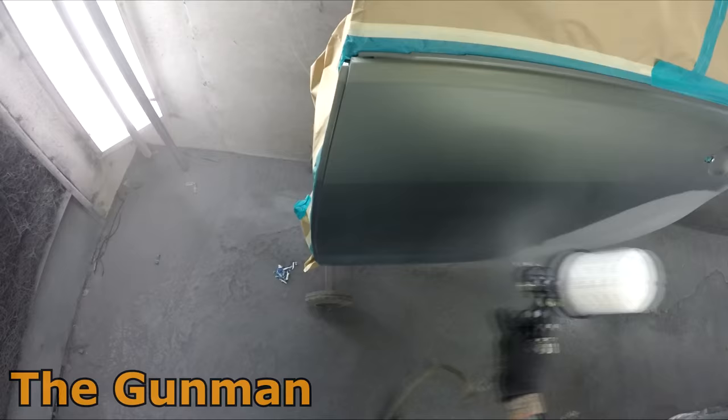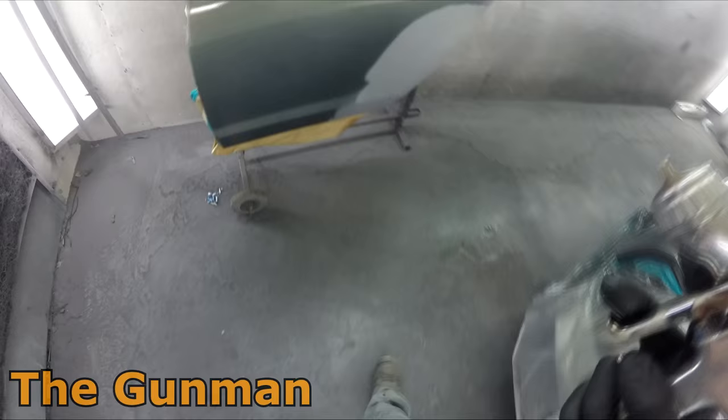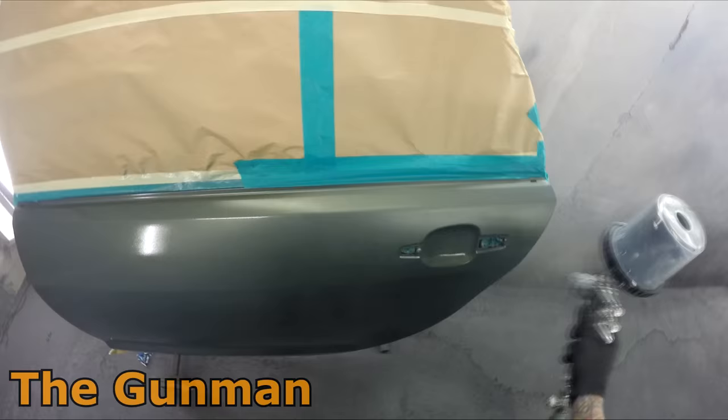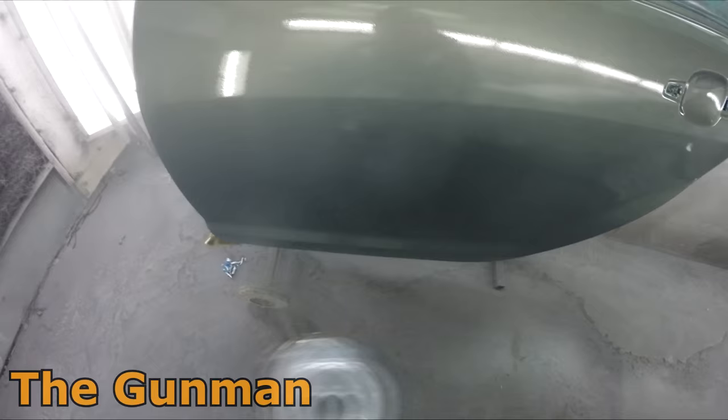This is probably the worst booth we've got, but it's actually got the best airflow. As far as waterbase goes, it'll dry down quicker so you'll get the job painted in less time. The gun I'm using is the Devilbiss GPI — another one I got from Spray Guns Direct, big thanks to them. This gun is absolutely amazing for waterbase. The GPI is the air cap, so it's not HVLP — these days I go for conventional, and I'd put this in the conventional cap class.